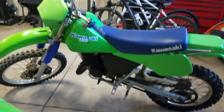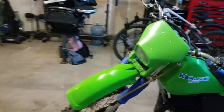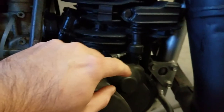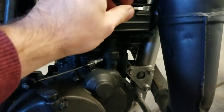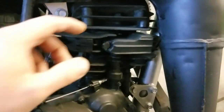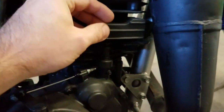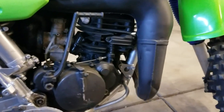Not much can go wrong with the '87 air cooled two stroke — just change the oil and the air filter, you don't have to worry about coolant or anything. The headlights don't work on this one though, I need to get lights going on it. I replaced the KIPS pin — it had a broken power valve. I had to take the clutch cover off and replace the pin. This little arm here actuates a governor that spins inside, and once it gets to about 6,000 RPMs it turns and opens a valve. There's a chamber where exhaust is held at low RPMs, and once it hits 6,000 RPMs the governor kicks in, twists the rod, and the valve closes off those chambers — directing all the exhaust gas out the exhaust pipe for top end power. Pretty neat little design — just an air cooled two stroke with a power valve.